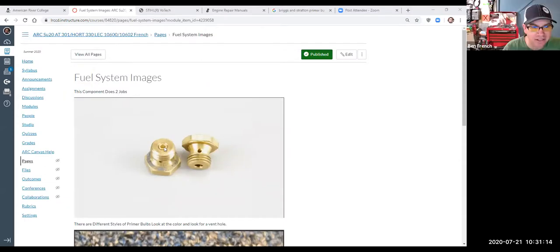But if I look right in the center, there's a jet pressed in here and there's holes in the sides. Because this is at the bottom of the float bowl, it sucks the fuel in the sides and then it goes up through the jet. So this one component is actually your main metering jet and it's your float bowl nut. So it's two for one. And maybe that saves them a half a penny per carburetor that they make. But when you're building, I don't know, 10 million carburetors, that saves a lot of money, right?